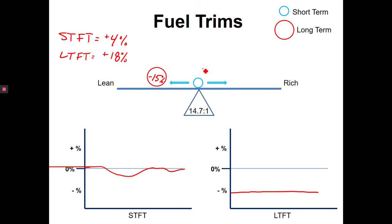Our short-term fuel trim is using our O2 sensor — that is what the short-term fuel trim uses to make its corrections. The long-term fuel trim uses what the short-term fuel trim is doing to make its adjustments. The O2 sensor is an input to the ECM; the ECM makes a very quick adjustment using the short-term fuel trim, but the ECM is monitoring what the short-term fuel trim is doing and then starts to adjust the long-term fuel trim in order to make any bigger changes that are required.